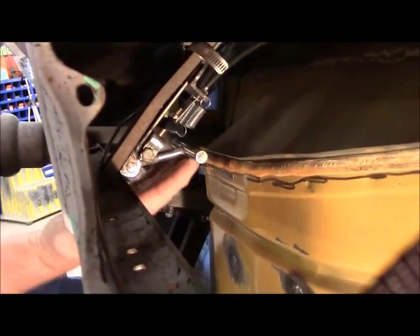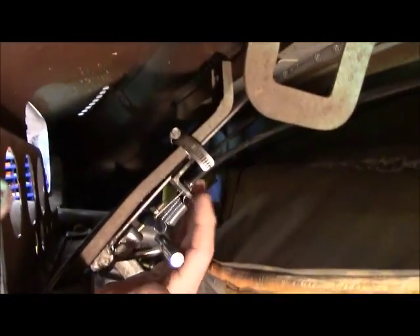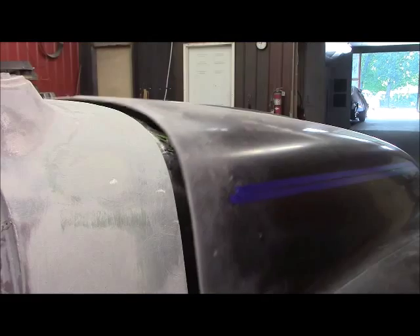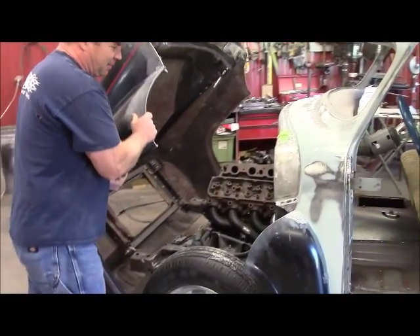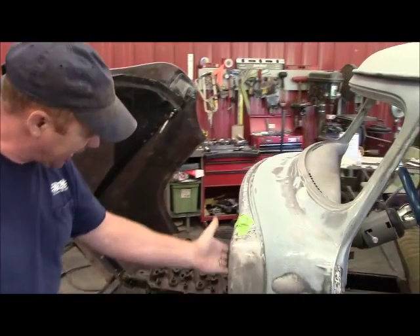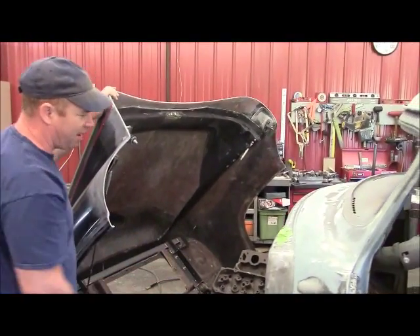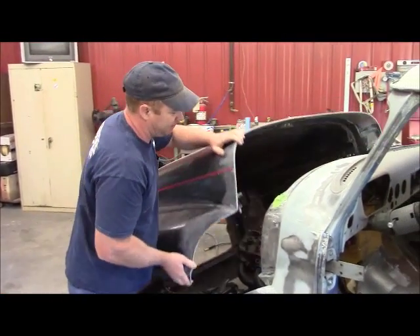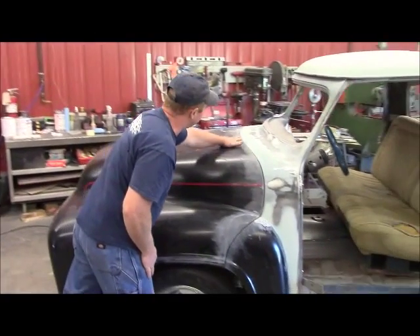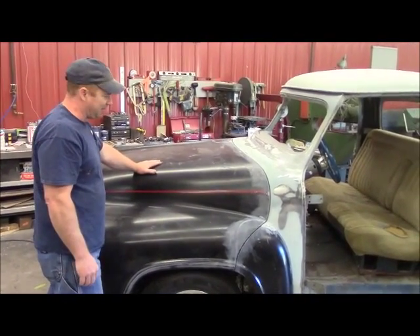Underneath the dash here, you can see all this is handmade. This is actually a converter installing tool, and the springs and cables came from the Ross and Sun salvage yard parts. You just grab ahold of this. Inside here you can see how we finished this up. I got rid of where the old hinge plates used to be, hammer formed this around, and added a little bit here. Cleaned this up and made these fit nice and tight with our springs and latches all in place. See how nice that front end shuts and closes — with my rake in there, that looks a lot better. I split that cowl, lowered that front, glassed it back in and this part's about done. It's been a pretty big job but I'm glad it's done.